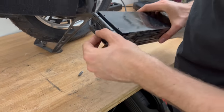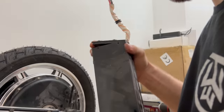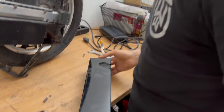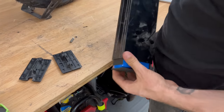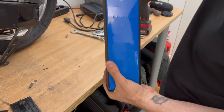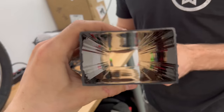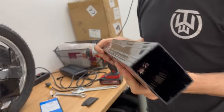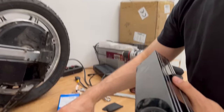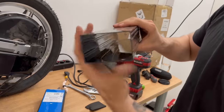Next we decided to disassemble a battery pack box. It was easy. Inside we have some foam — and more foam. One has a hole in it. I'm definitely happy to see cell-level fusing here; it wasn't present on the S22 for example. But the battery box itself is incredibly flimsy — that's the flimsiest thing I've seen. That's like happy-meal quality. Even the foam bends it out because the plastic is so weak — it was probably flush originally but now it's curved.